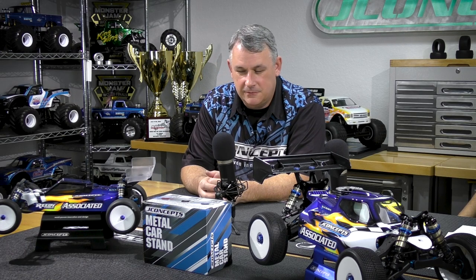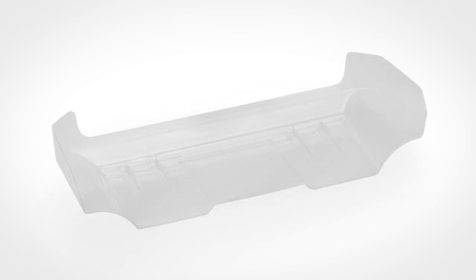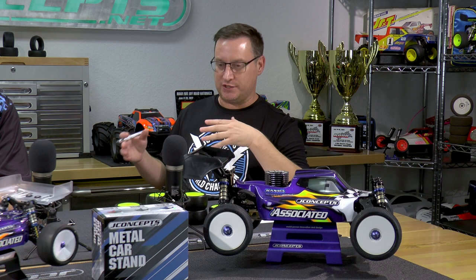When a wing is perfectly cut out and trimmed and you put it on, it just feels good. It makes you a more efficient racer — hitting the easy button on some of this stuff, you just want to bolt on a part and go rather than sitting there trimming and wondering if you did it right. Having the pre-trim makes you more efficient in the pits so you can focus more on your racing — just slap another wing on and go. We trimmed the rear gurney height to what I'd say is the most popular setting, though you can keep cutting the gurney down for big jumps or windy outdoor conditions.